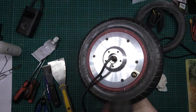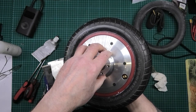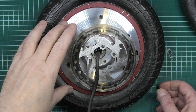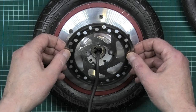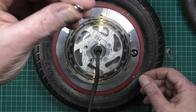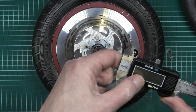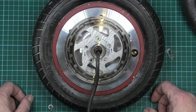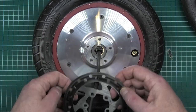After you've done that, go around the center where the bearing is and give it a few taps — that's literally to get the bearing to seat properly, or to get the outer race to seat on the inside. When I fitted the disc, I couldn't get the disc in the right place, so I had to put one-millimeter washers behind it. I don't think I could get a spacer at the time, so that's what I used — just 1mm washers. I've got to put those back on.